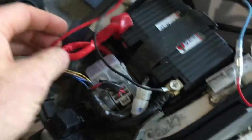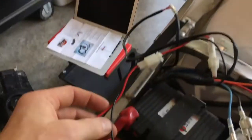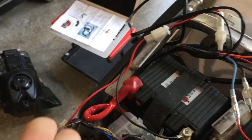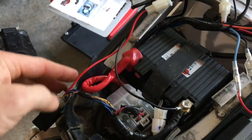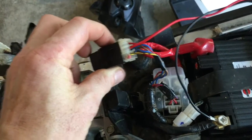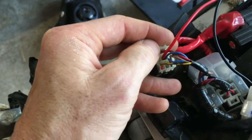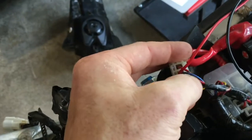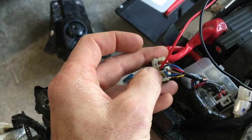And then coming on up to the front up here, the last 2 things you've got left are your main power wires. Now, if you just wire these in to the battery, then your tail light is going to be on all of the time, because remember, I wired those 2 wires up front together that are supposed to be switched. So the way you're going to get around that is up front up here, there's 2 relays. One is the starter cutoff relay, the other is the headlight relay. And the headlight relay on mine is the one that has a red wire up top, blue wire in the middle, and then blue and yellow wires at the back here. The blue wire in the middle of this relay is the headlight, so that when this relay kicks on, it kicks on the headlight on the bike.